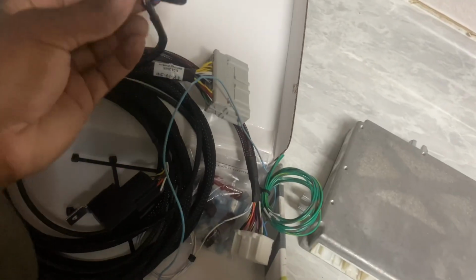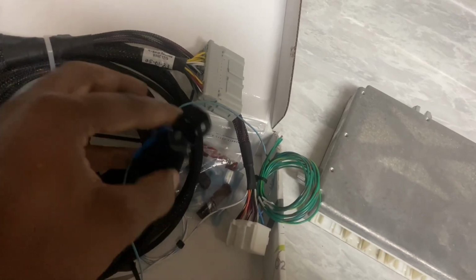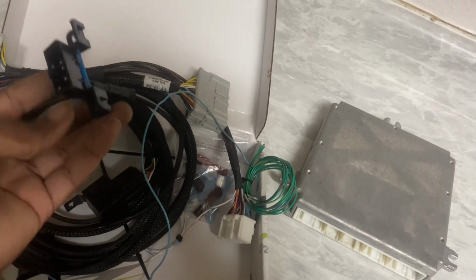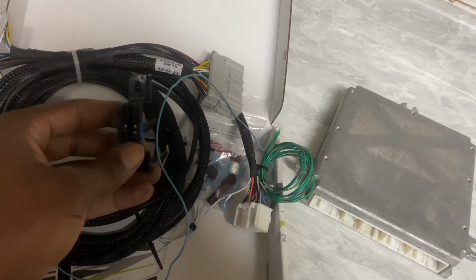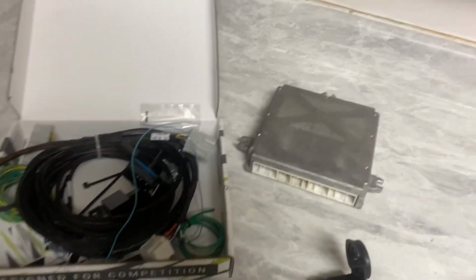You will be able to run your DLC. This is your DLC for check engine light, since 92 through 95 usually come with jumpers. And you read usually with the flash, but since you're updated with all OBD2B stuff from the RSX, you can actually use this and use a scanner. And that's pretty much the basics of wiring a stock ECU on the conversion harness.